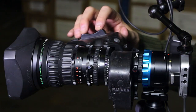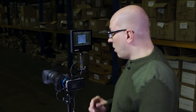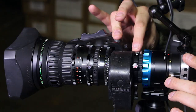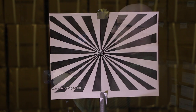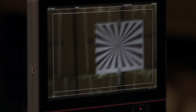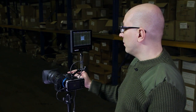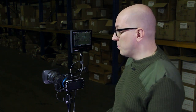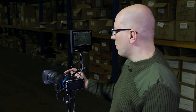Then what you do is zoom all the way in. While you're zoomed in all the way, loosen the little thumb screw and start manipulating the back glass. You want to get it to look nice and sharp in your monitor. You're going to notice there's a range in which it looks sharp, so try to find where it's sharp, take your hands off, and then zoom out. Now it's very likely it's going to go soft as you zoom out, and that means you've got to wiggle it a little more, make a couple more adjustments, try to get it back in focus.